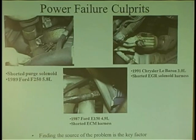Now look at this here, right? EGR tubes, common, where things will melt against them. AIR pump tubes, same thing, the air pump, the hot tube that goes into it. Here, exhaust manifold, right at the back of the engine here. Look at this guy, this EGR sensor, EGR solenoid harness, got melted on the exhaust here. How about a van with a doghouse where the harness lost its conduit? Or maybe it cut through the conduit, and look, it's chafed right here on this red wire.